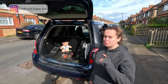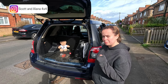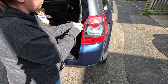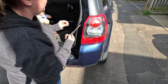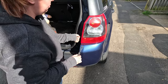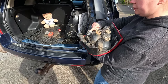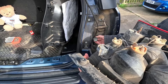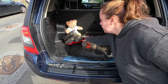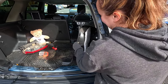Hey guys, welcome back to another video. This one's been very highly requested, so today I'm going to talk you through our CB radio setup. The first thing you need to do is remove your backlight. I've already done ours so it's going to be nice and simple, but it is just attached with two screws around this side and then two poppers around the other, and it pops off. Then the connector from just here just pulls out and it's free to release.